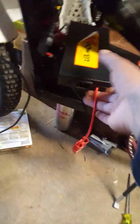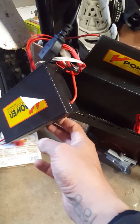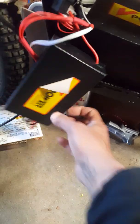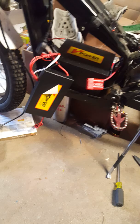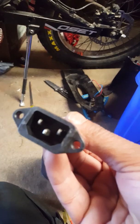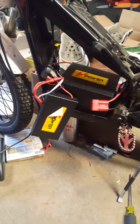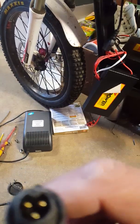I did some custom wiring. The BMS is all part of this one, or this one that's kind of separate. I got some Anderson connectors and did some custom wiring because I didn't want the same charging ports — if you plug the 48 into the 36 that can do some damage. The BMS should cut it out, but for simplicity I took the old OSET one and hacked it and put it on the new charger.